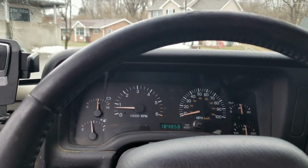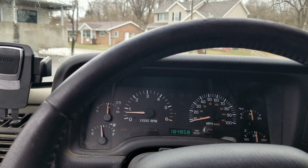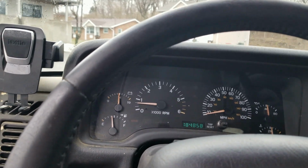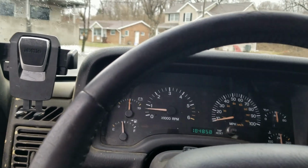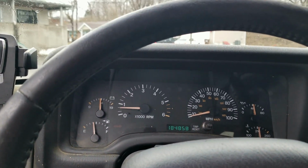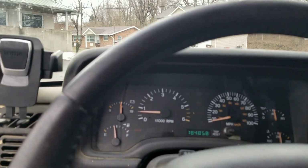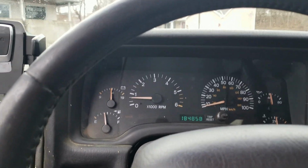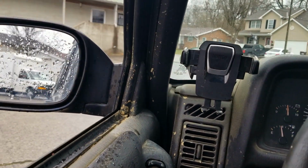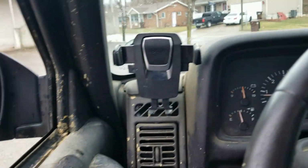And I still have the 75W90 gear oil, the Jeep recommended gear oil, in my Jeep. I do not have the 90 to 140, I think it is, that other people put in their Jeeps to make the lockers quieter immediately. So it is possible to run the lighter gear oil and still have it nice and quiet.